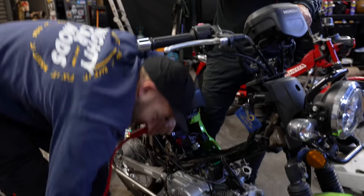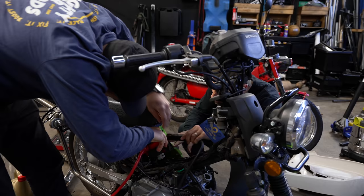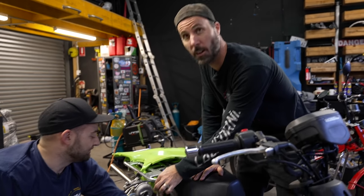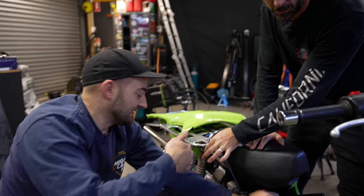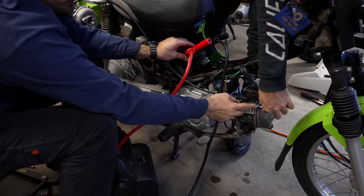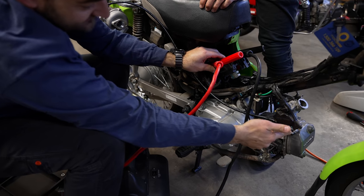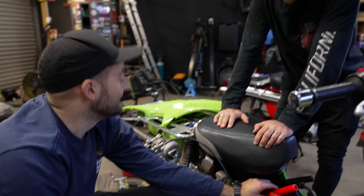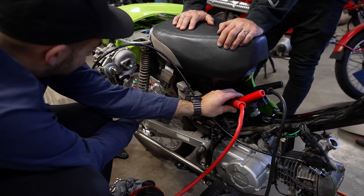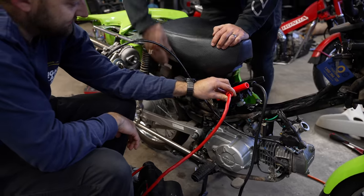Since people have been here last time, we've got a custom oil line. I plugged that in — basically, last night I had to go and get one of these lines, custom made, because it didn't have the fitting. Drilled a hole in there, tapped it out. Custom made. It's so good. It takes all pressure from up here, sends it into the turbo. At the moment I don't have it in the bottom of the turbo, so it should just leak oil. But we are going to drop that back out into here where the dipstick is, and then we've got our oil going around and around.